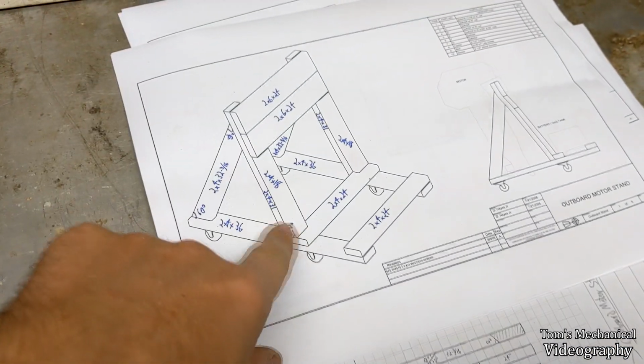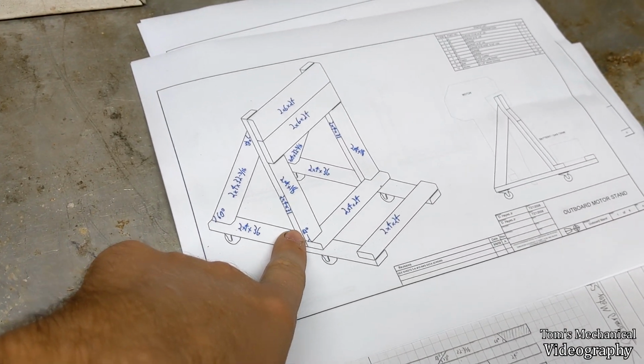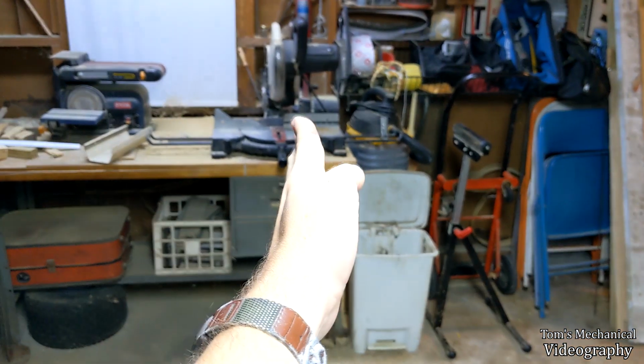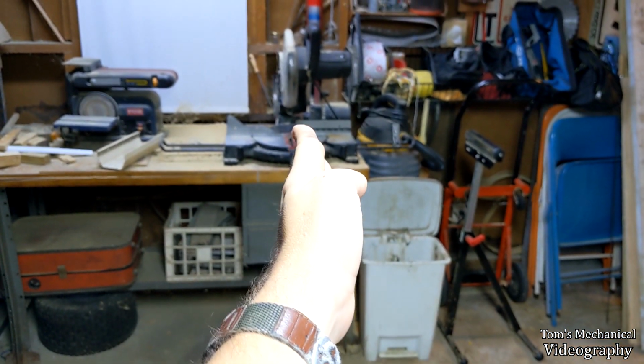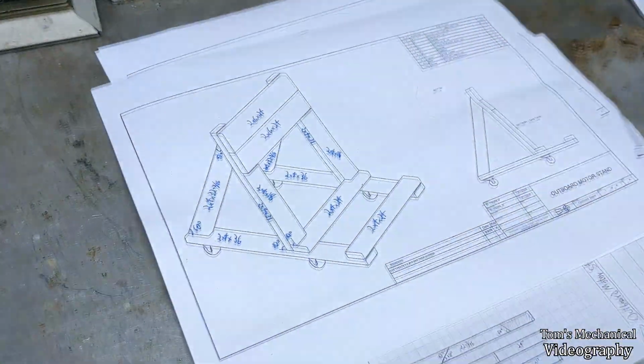The alternative is that you can cut an 8-degree cut off of the tip of this thing. You can put the board straight in the saw like that, and then set it to 8 degrees and snip 8 degrees off the end, and then you'll have an 8-degree and an 8-degree, and that'll square that back up, and then you can slide it up there flush. That's a lot easier, and you can do that with a chop saw like I'm going to be doing.